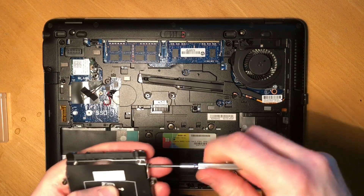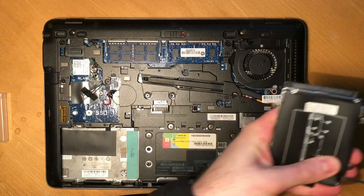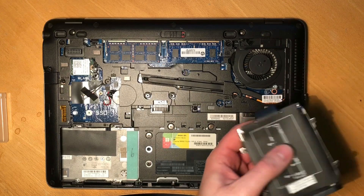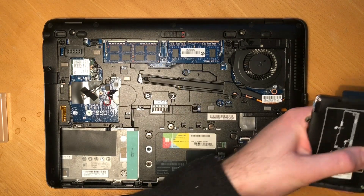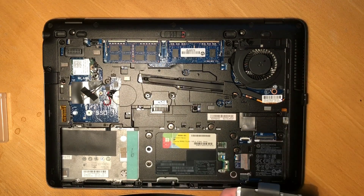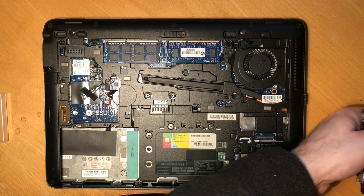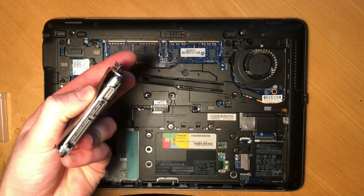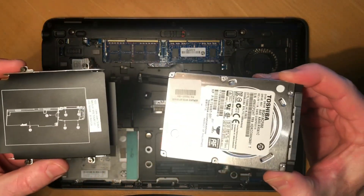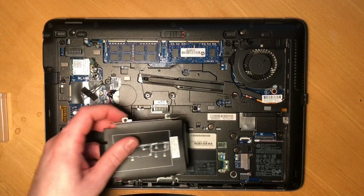The hard drive itself is secured to the bracket with four screws, one in each corner. These can be removed completely — place them somewhere safe because you'll need them. In this case we'll be installing a solid state drive, but it will fit any standard two-and-a-half inch drive, which obviously should have a SATA connector — that's required.